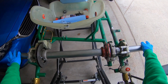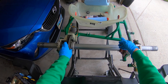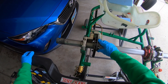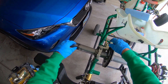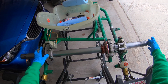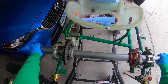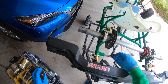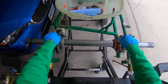We've taken off both wheel hubs. Now it's just removing the brake hub and the brake mounting so that we're able to hammer this portion of the rear axle and push it out. Let's get to it. On this one I've already loosened them, so you can almost freely move it.